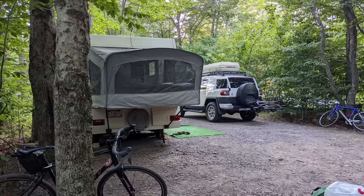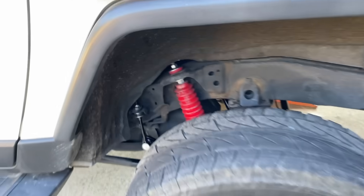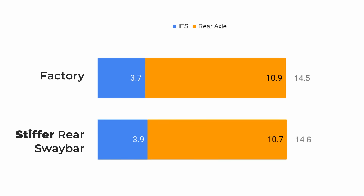Peter has no interest in technical wheeling — he and his wife tow a trailer and do a lot of car camping. Peter actually wanted even more highway stability than stock, so I helped him install the same stiffer rear sway bar like mine, and of course he still had the front one in place. He loved the new handling, especially in towing. What I was interested in is how this changed his articulation — we basically traded a little bit of rear flex for front flex, but the total articulation remained the same. I will show a mega summary of all data at the end so you can pause and review. Thank you for watching — go check out my website and subscribe for more videos just like this one.